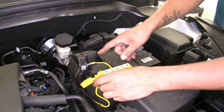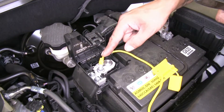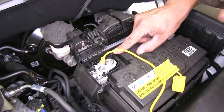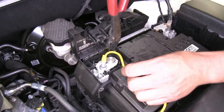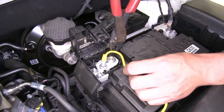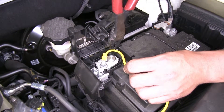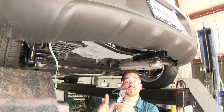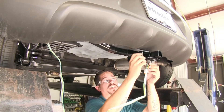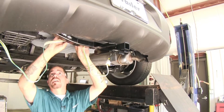Now all we have left to do is tidy up our wires, put our fuse in, and make sure our lights are working. In order to get our cover closed on our battery terminal, I moved my wire around the post and cut a small relief so that my wire can fit down and I can lock my cover — just use a pair of side cutters to cut the plastic just a little bit to make a notch so the wire can fit down and won't interfere with the cover. The last thing we need to do is get our four-pole connector over to the center of our hitch. I'm going to take the dust cover and attach it to my hitch, then take my excess wire and tie it up behind my hitch.